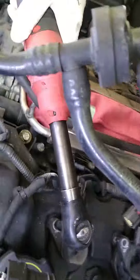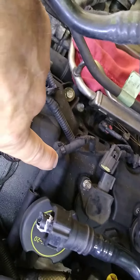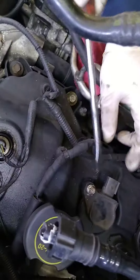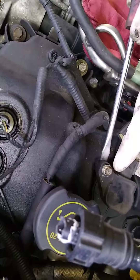I just pry the coil out, and it'll pull the threaded section — it's like a threaded rivet — out of the valve cover. And if it pops a hole in it, don't be concerned, it's not a big deal. So let's see if Caleb can get it out without destroying the whole car.